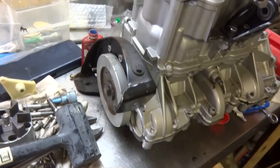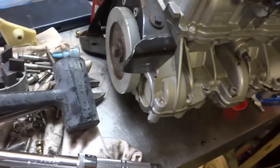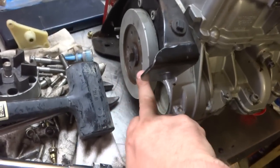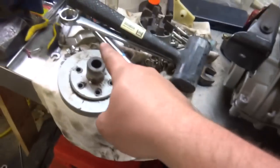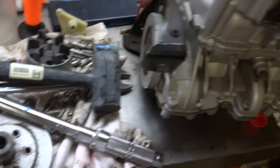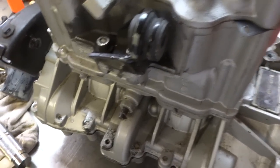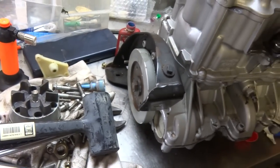I got that torqued up — I didn't show it in the video because I had Loctite already on the bolt and wanted to get it in quick. To tighten this without the engine turning, I put a nut on the opposite side and used a wrench, then tapped the flange with a rubber mallet and torqued it down again. Because it's a tapered fitting, I know for sure the flywheel won't spin. Now I can put this bushing in place and the back side is done.